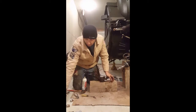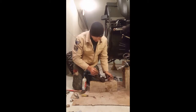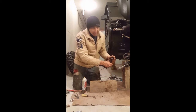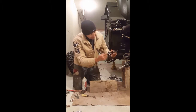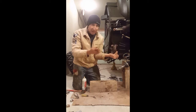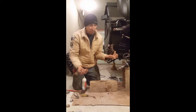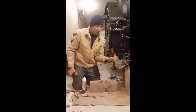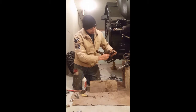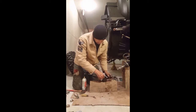So now what you're going to need is a punch of some sort. If you got a flat punch, that is what's going to set on the edge of the outside bearing. Okay, so I'm going to try to punch this bearing out first. You cannot beat these things through, because there's like a lip inside of there, so you can't think, oh yeah, I'll just push both of them through that way. No, you cannot. There's a lip there, so it stops that from happening. That's what that spacer is riding on right there. And you'll see that that's worn out too, but that's another story.